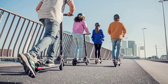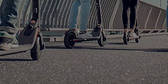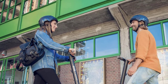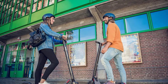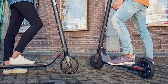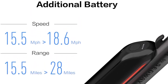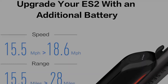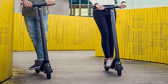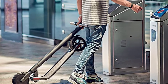The ES2 uses a front shock absorber for a smooth ride over rough terrain. This e-scooter has solid rubber tires, which are maintenance-free though typically less shock absorbing — the front shock pad helps make up for this. The front tire is 8 inches and the rear tire is 7.5 inches. The ES2 has zippier acceleration because of its 300-watt motor. In sport mode it sacrifices some of its 60-minute battery life for improved acceleration. It won't go faster than 15.5 miles per hour in either sport or normal mode, but you can set a manual limit in beginner mode through the app.